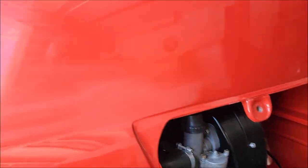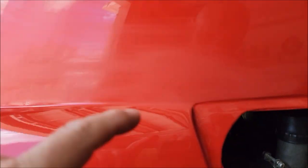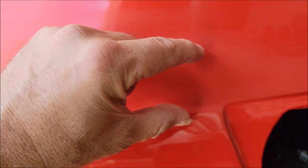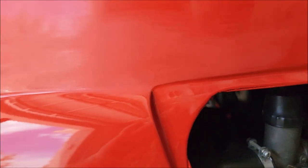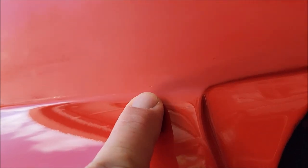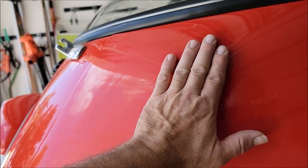I'm doing a little wet sanding with some 2000 grit. In the area where all that body work was showing through, I just gave it a little sand until I felt I had to stop. I believe I can successfully get all these scratches out with no problem. All that's left from that issue — the crazy ripple that was in there — is just that little dot and then that dot right there, and a little bit right there. You can see the gloss on the dots, that's super deep. But overall I got the ripple gone so those aren't even going to be a big deal once I get it polished out.